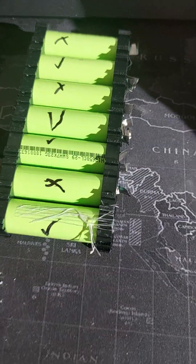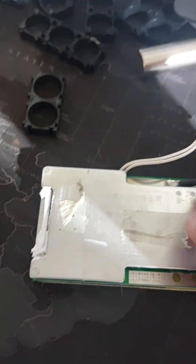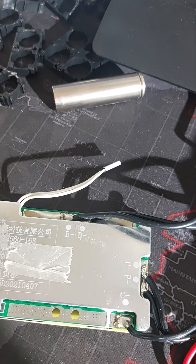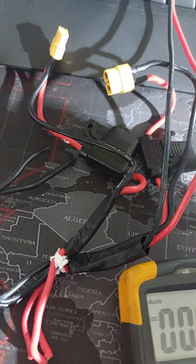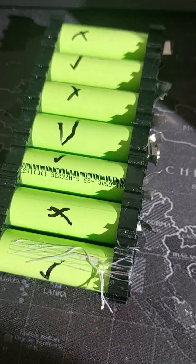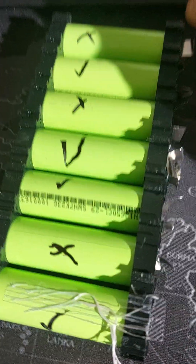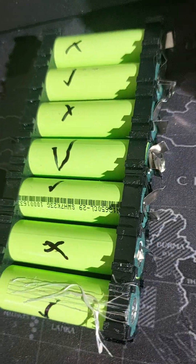So you could say you just need to reset your BMS — wherever that's possible. On this one I don't think there's a reset on it, but certainly on some scooters like the Segway or the Xiaomi's they do have a reset button. I'm not 100% sure why they need that, but even if you supposedly reset your BMS, it won't make a difference. You need to open up the battery and do what I've done to really determine whether it's working or not.